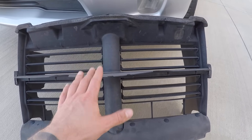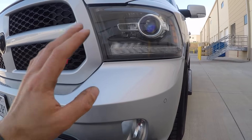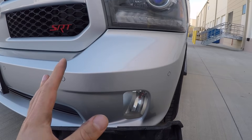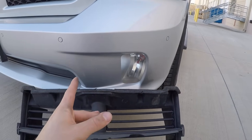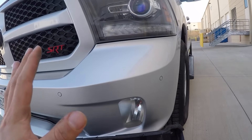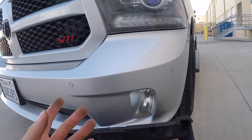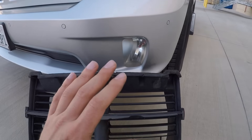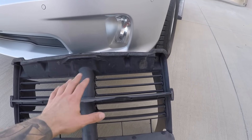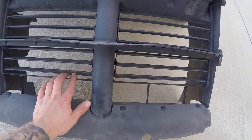Why are these on the truck? They're on the truck for efficiency reasons. First, they want the engine temperature to come up to operating temperature sooner and faster so it can run more efficiently. The stock thermostat is set at 203 degrees — 203 degrees is pretty hot. It's not performance-oriented; it's more from an efficiency standpoint. Everything runs and burns a little bit cleaner and you can have cleaner emissions. So this system is trying to get the truck up to 203 degrees and keep it around the 200-degree mark.